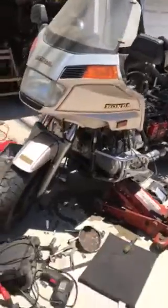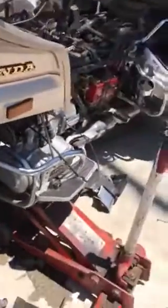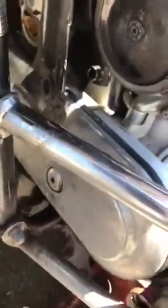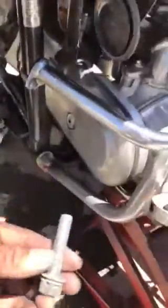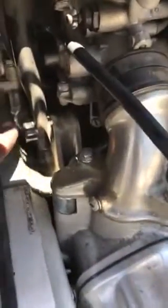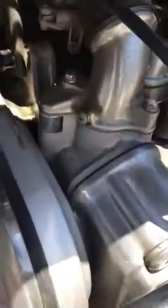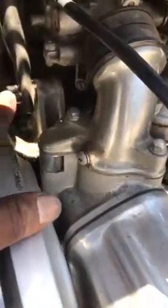Open up the thermostat housing — this is the thermostat housing, it goes under there. Now we're under the bike, at the front of the bike. You gotta jack up the motor a little bit, because you'll have to remove the bolt that holds the motor mount — basically it's a motor mount, because it goes in here. This is connected to your motor, like a motor bracket. So remove that.